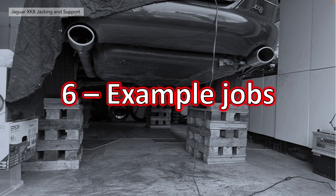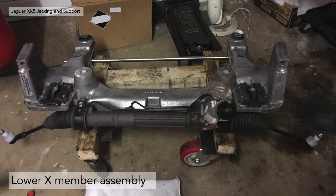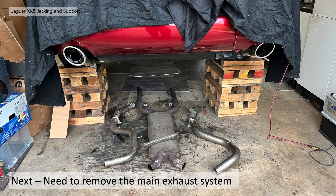Some example jobs we've done using these blocks. A single set of blocks is used to remove the crankshaft position sensor, and also gives access to the radiator drain plug — though I've never removed that because I'm frightened of damaging it. I've removed the front suspension by supporting underneath the sill — here's the whole lower cross-member assembly completely refurbished with V-mounts and hydraulic mounts. I also removed the rear suspension using a similar method at the back — the rear suspension assembly here all refurbished and painted with two-pack. Next, we need to use the same blocks to remove the main exhaust system, which is what we'll cover in the next video.